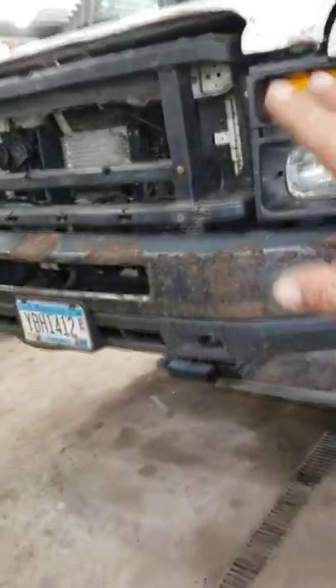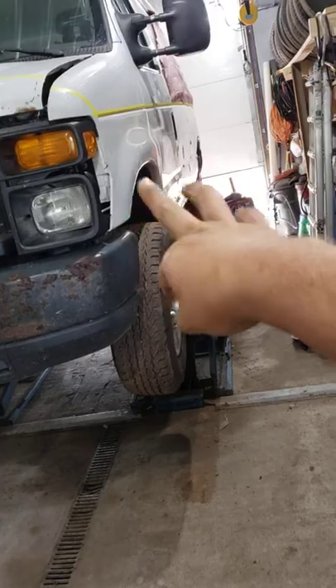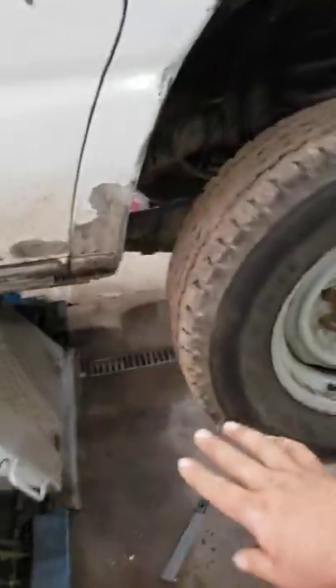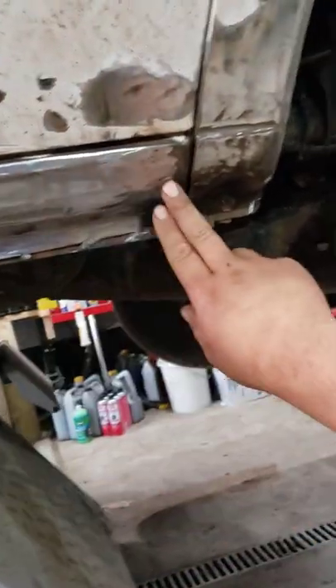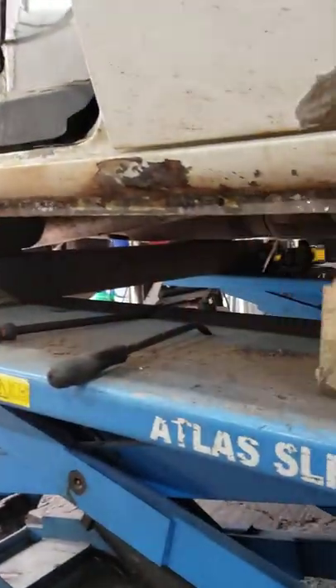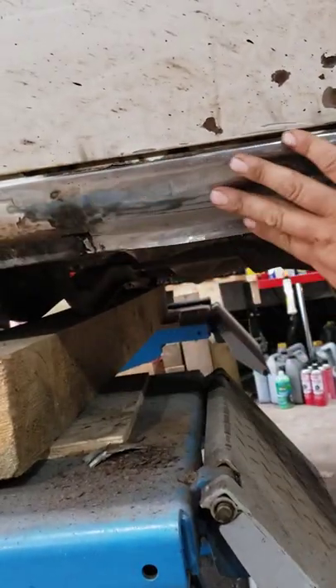Realistically, it's probably not worth it on a van with almost 360,000 miles on it. They have no problem putting the work into replacing a powertrain, but that particular area I'm not too terribly worried about. So we'll probably dress it up cosmetically. This pinch weld over here isn't too bad — you can see in the previous video we had that hole there, so that's been patched. The spot weld and the weld down here I'm not too worried about, because it's going to blend with the rest of the seam. Pinch welds on any vehicle aren't necessarily pretty. So we got all that patched and blended.